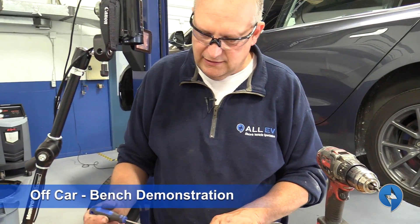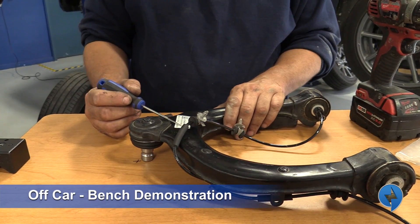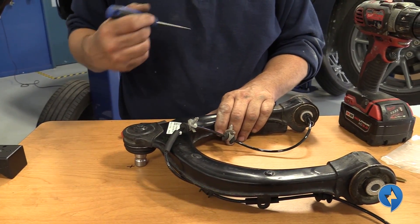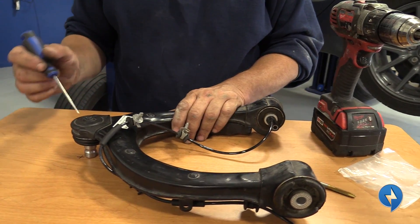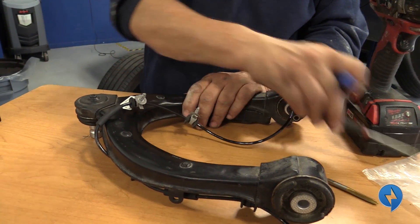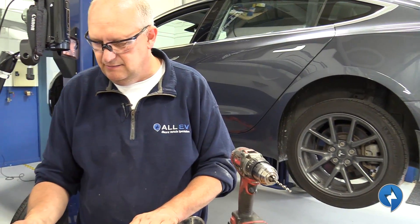What we're doing — we can see this is a newer revision of the control arm, this is revision G. Typically the A's and the other ones had problems with their amount of grease in the ball socket area. They would go dry and start squeaking. This one's G, and technically doesn't need it, but you can almost see there's a spot there for a Zerk fitting.